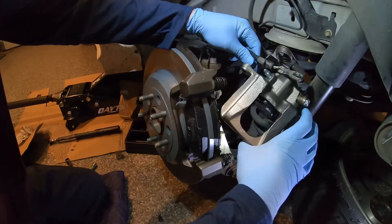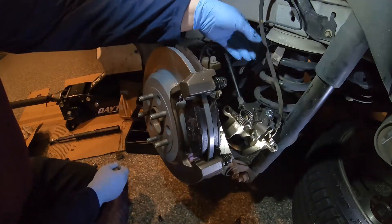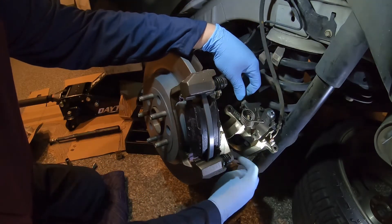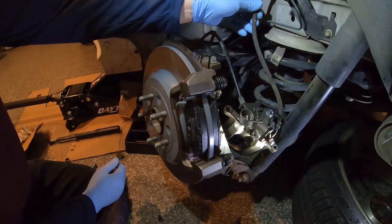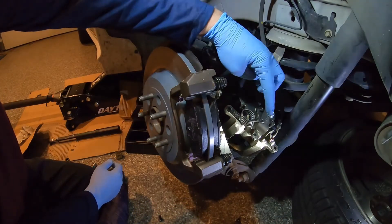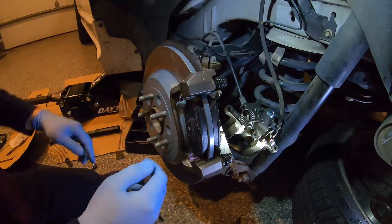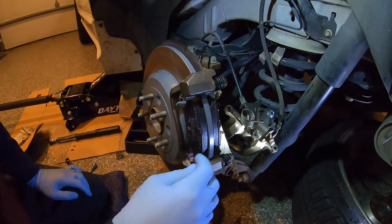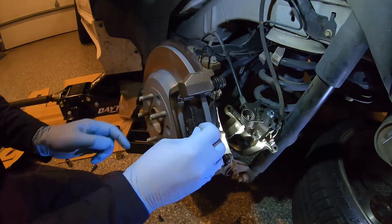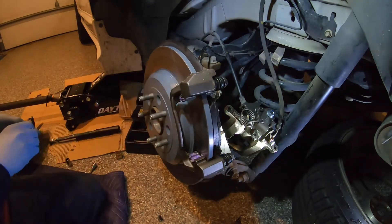The parking brake line is a little bit shorter than the brake line so it's not going to hang on the brake line — it kind of perches right in there up against the shock. Just make sure there's no tension on your brake line. If you're a little worried about it, run a zip tie from here up to here and just let it hang there. Now you can remove your brake pads — wedge a screwdriver or pry bar in there and slide those out.